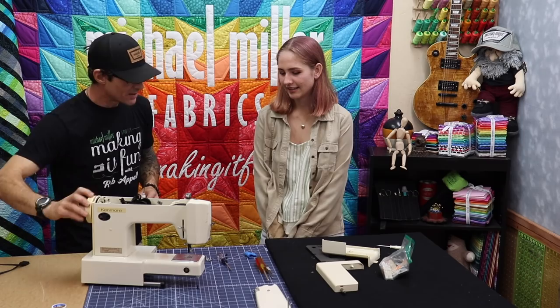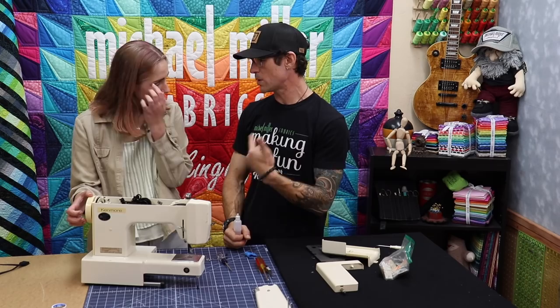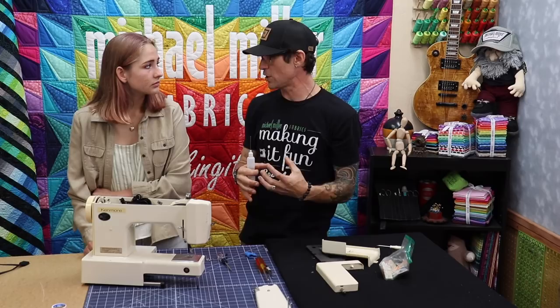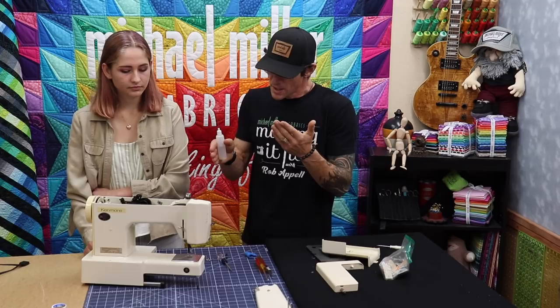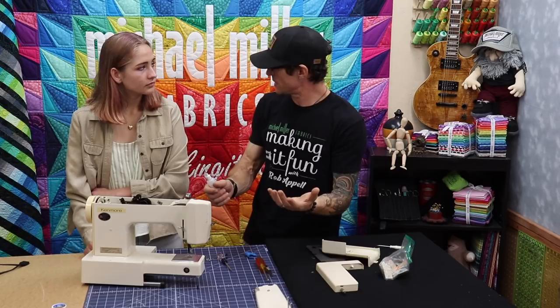I would like you to handle the hand wheel because you need to know what your machine feels like. Anytime a machine starts to get stiff and sticky and not feel good, it means the oil and the lubricants are drying up. If you get a machine that you don't know its history on, please just think of your machines like automobiles. You want to use it a little bit at a time, and don't let it get too overheated. So, will you keep turning that a little bit for me? And go ahead, stop, perfect.